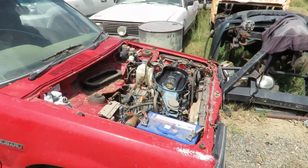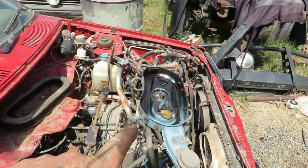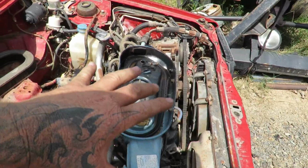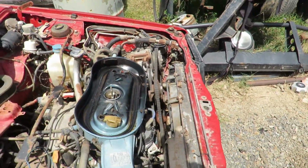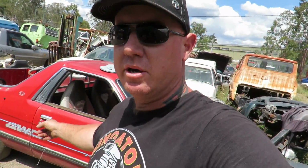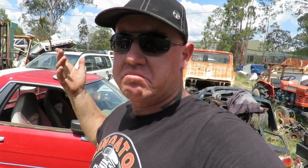At this point, there is an engine swap going into the other car, which will end up rear wheel drive. That's in another video. With this one we're going to try and retain the original engine, and we have a small supercharger there. We'll make up the manifolds that sit there, drawing through the carby, so that'll help this thing chug along. It'll retain the 4-speed box because you don't really need a 5-speed once you put the big wheels on it, and it should be pretty sweet.